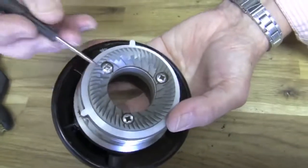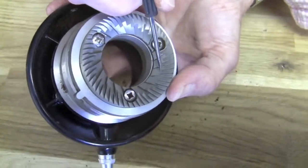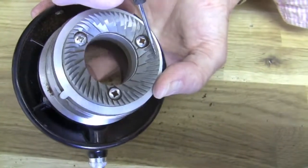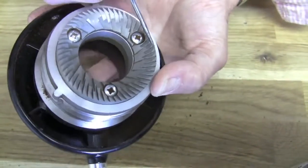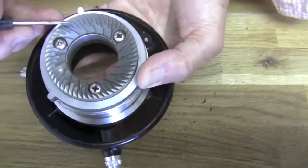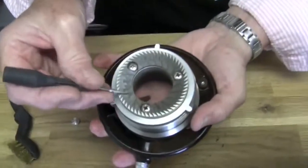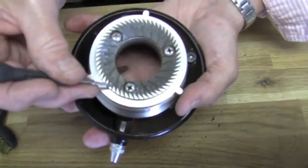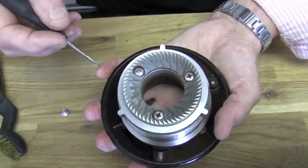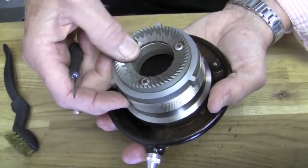The other thing: there are some shiny spots here — can you see those? They're little nicks. When you see shiny spots, sharp surfaces don't have flat surfaces to reflect light. That shiny spot means you've got a little nick there. Not bad — I wouldn't worry about it just yet. If you start to see some inconsistency in your grind, that's a sign. This burr is only probably a quarter gone.